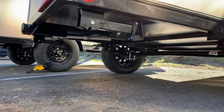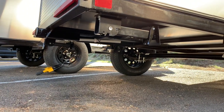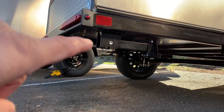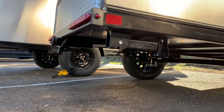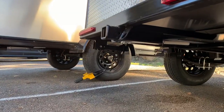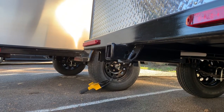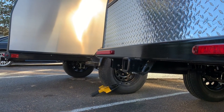Here's a look under the chassis. Unlike some builders, we actually shell the bottom with aluminum, which gives you a nice seal down below. We also build an insulated subfloor, which keeps it a bit warmer than just treated plywood. A couple of options right here: rear stabilizer jacks — not really needed unless you're doing a rooftop tent, but if you are, it's nice to have so the kids messing around up there don't jostle the camper. We can also add a receiver hitch, great for a bike rack or cargo rack — rated for 200 pounds. If you do a bike rack, we recommend the kind that swings out so you don't have to remove the bikes to get to the kitchen.